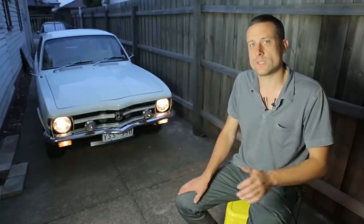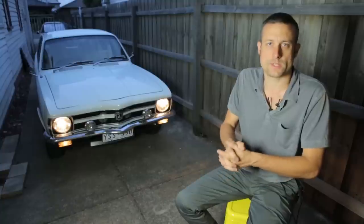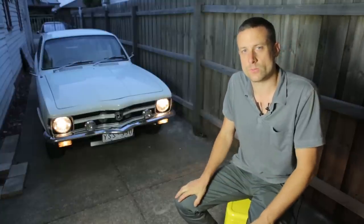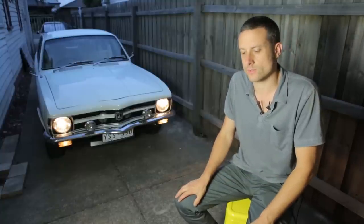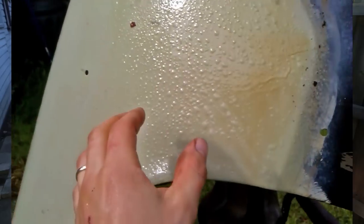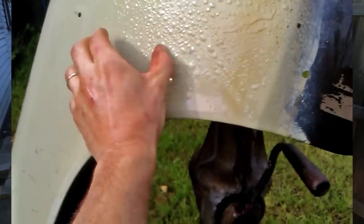The paint was certainly set, but I suspect it wasn't 100% hardened and cured. Then I put it in molasses for two weeks and the result was the paint was blistering and the steel was stained underneath. What I did was I wasted materials and created a whole lot of work for myself.